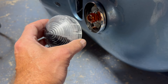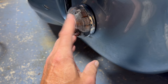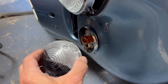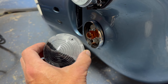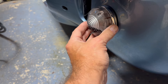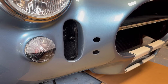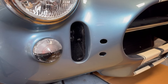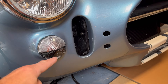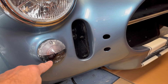So I've simply painted the inside of my indicators here - the same as AK do. By fitting that paint, the indicators won't show in the bottom half, only in the top half which is above the minimum height. I've done this in water-based paint, hoping it's scrubbable out, otherwise I'll just buy new lenses. I just need to go over it a couple more times to make sure no light comes through the bottom half. The minimum height is 35 centimetres from the ground.